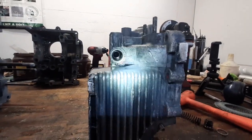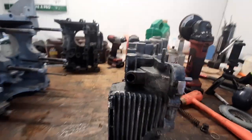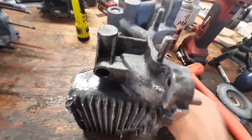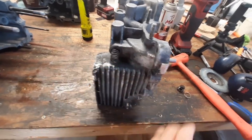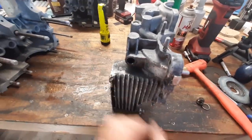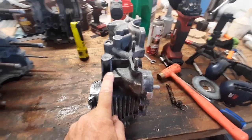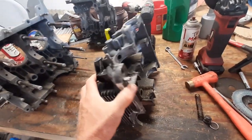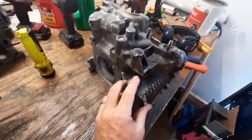Up in that hole is a valve that right now I'm not able to get out — it's stuck in there. That valve is spring-loaded and it's got a plug that holds everything in place. This is what they call the dual relief case — it was the more modern case. What happens when you start the motor and the oil is cold...